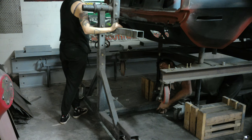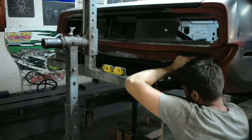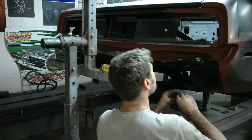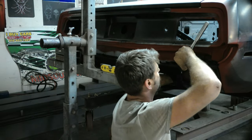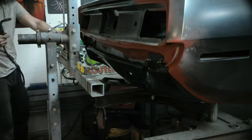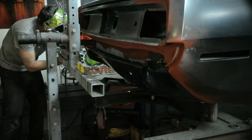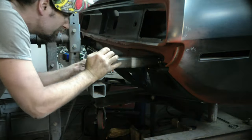You're gonna see how the mount-building process works. I cut some 5/16 plate steel about the same size as the factory bumper mounts, and I'm using grade 8 bolts on both sides, bolting them into place — this is my base for welding bars off of it. We're going to use two-and-a-half by two-and-a-half, 5/16-inch square tubing going right through that slot area. The car is sitting about three inches above the rotisserie on both front and rear.